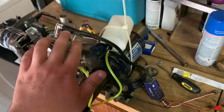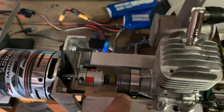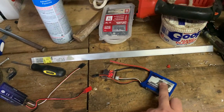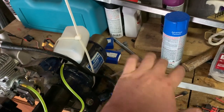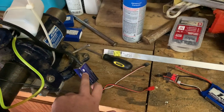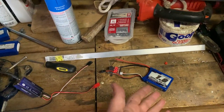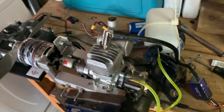I have the ignition hooked up. There's an ignition sensor that goes to the crankshaft — it's this little black piece right here — and a wire that comes off into the ignition. The ignition is powered by a separate battery. This could be powered by the main power, but it's a different voltage and I don't have a regulator that can supply enough current, since it takes between 6 and 12 volts. For now I'm just using a two-cell lipo, which is what's usually used in electric or gas airplanes for ignition and servo control.